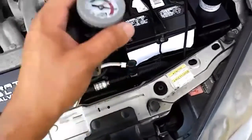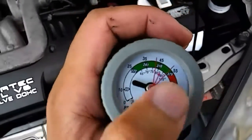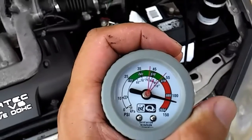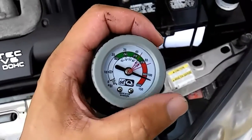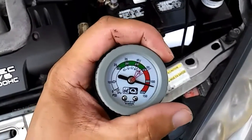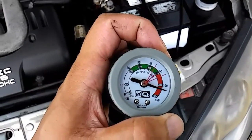Once you connect it, it will look like this on the red — that means the engine is off. You'll see this dial right here with these little numbers; it will indicate the current temperature. Right now I'm in Florida and it's like 101 degrees, so I'll keep it right here. When you put the vehicle on and the compressor starts running, if this arrow goes to the white, that means it's low on charge and you need to recharge it. If it's somewhere below the current temperature reading, that means it needs a little recharge.